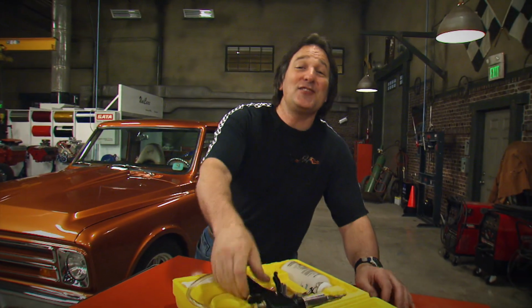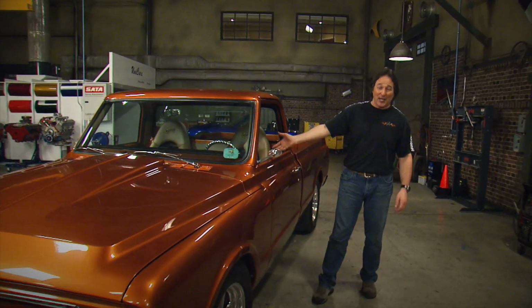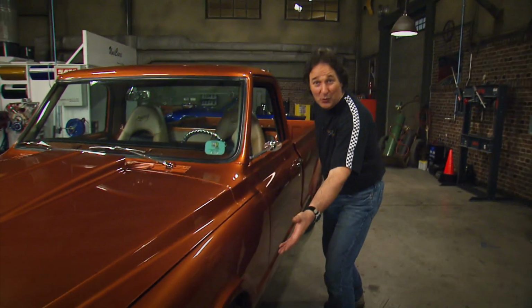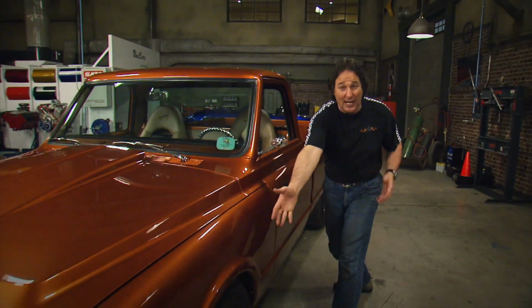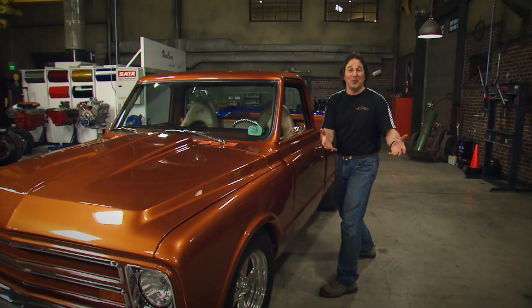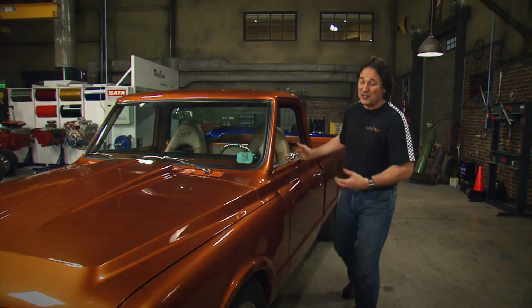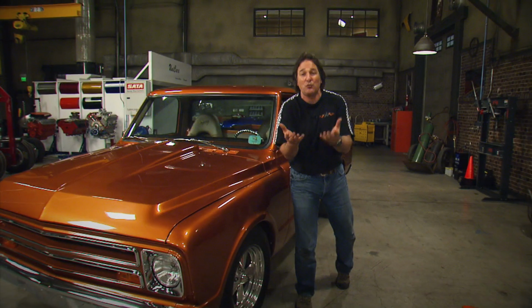Now, in the past, the scenario has always been you get Cousin Eddie or Aunt Thelma inside pushing on the pedal while you're down opening and closing the bleed screws at the wheels. And in doing this, hopefully you run all the air down and out through the bleed screws. The problem with this, other than Cousin Eddie hitting the pedal at the wrong time, is that you're shoving that air in exactly the wrong direction. The air wants to rise.